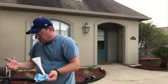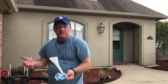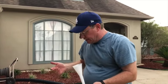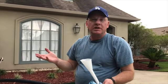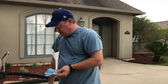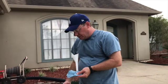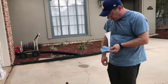And then once you change that oil, I would recommend using 10W30 synthetic oil, whatever brand you like, and that would be good for 100 hours of runtime. So it's either 50 or 100. I think it's 100, which would be 4 days of running a generator all the time.